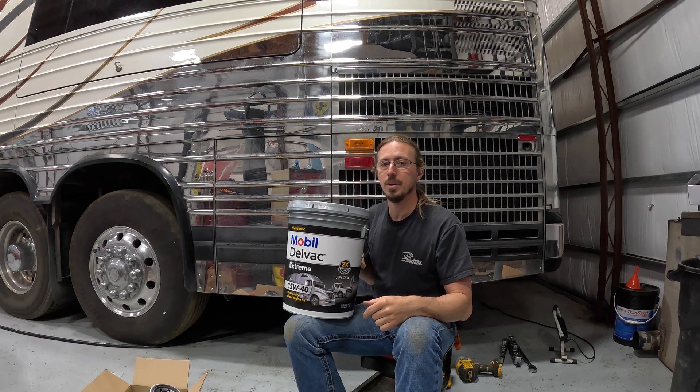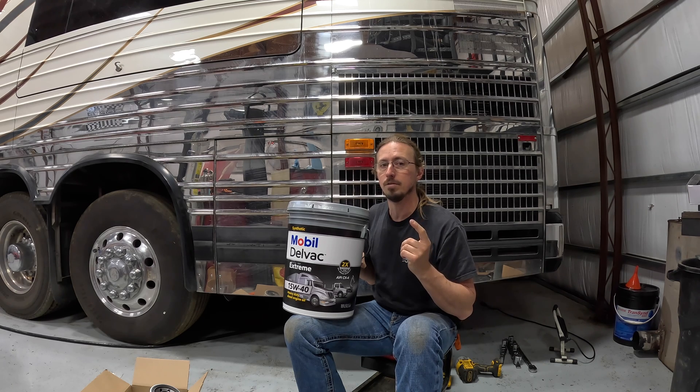The next question was which oil brand to go with. There were a few things that played into this, including cost and the ability to get it in a 5-gallon pail. Quality of the oil matters, but cost and the ability to get it in a 5-gallon pail was important because you're talking about 10 gallons worth of oil that this engine takes. After doing a little bit of digging, I decided the two options I was going to consider were your standard Shell Rotella 15W40 and alternately a Mobil Delvac 15W40. I ended up going with Mobil Delvac Extreme 15W40.